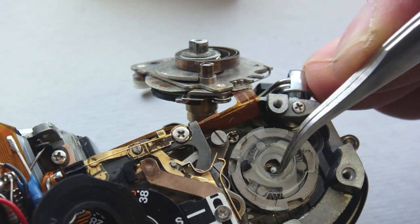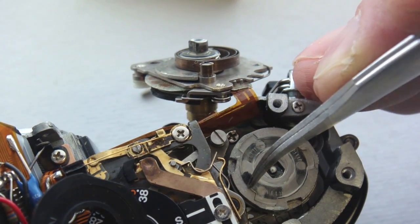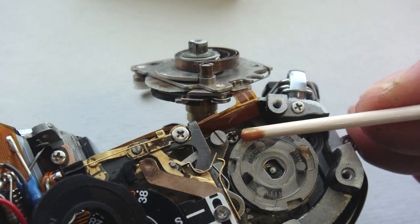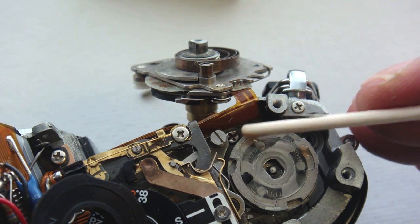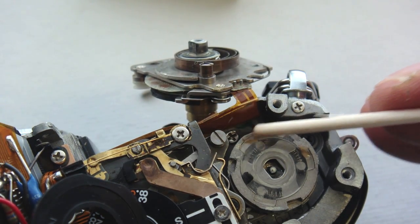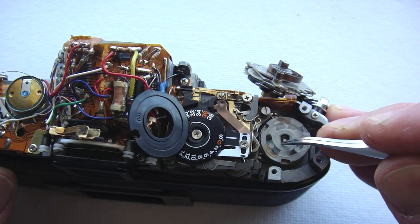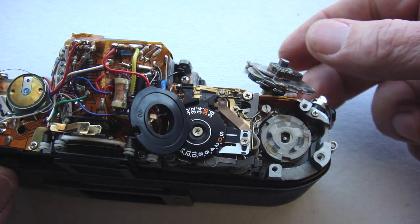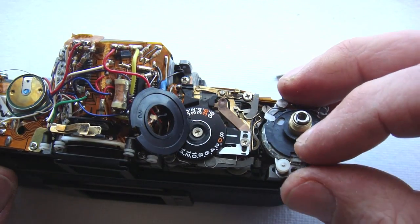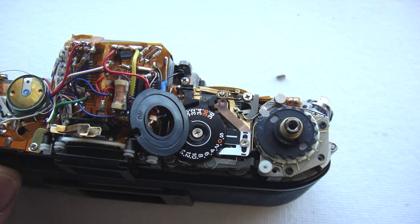Take care while moving the plate into position that you do not disturb the wind bearings or springs. Once the plate is positioned properly, dab with a drop of Pliabond glue. Now position the wind ratchet to receive the upper advance lever mechanism. Slightly tilt the mechanism and move it into a position to where it drops into place.